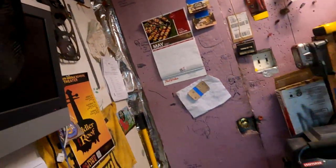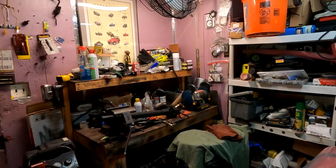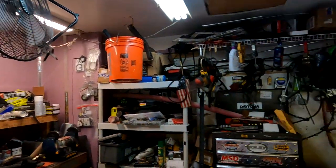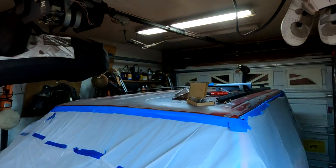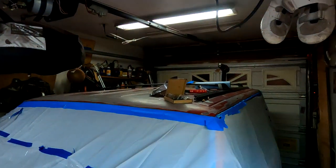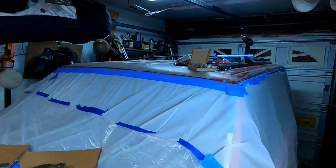And please, folks, when you're using a propane heater, get a carbon monoxide tester and smoke alarm combo. Please always make sure you get yourself some fresh air now and again. Have your carbon monoxide tester working because you just never know. Propane is very clean, it's very safe, but you never want to take that for granted. So when you're using propane in an enclosed garage, have a carbon monoxide tester, save your life. Because you can't smell carbon monoxide, and you don't want to be dead. Everybody's like, I wonder what he's doing in the garage. You know, 10 days later, they come look for me. Kind of a bad story.